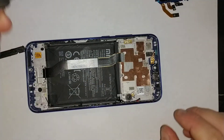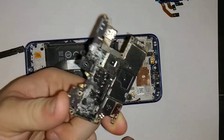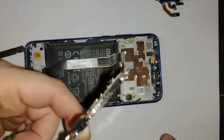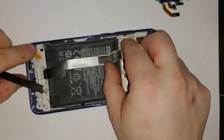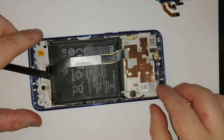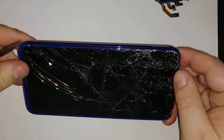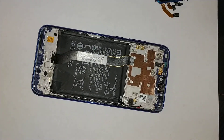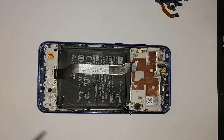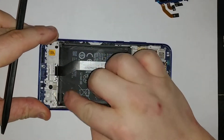There's your front-facing camera right here. As you can see, it has water damage — water gets in fairly easily on this phone. Here's your battery, and there's your screen. If you want to pop the screen off you'll need to heat it and it will come off. To remove the battery, there are two adhesive pull tabs on the bottom — peel them off and pull the battery up, similar to an iPhone.